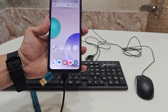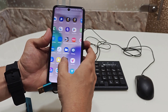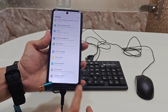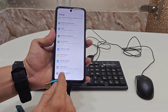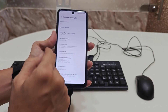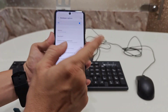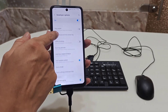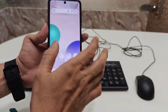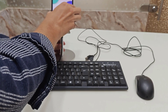After connecting, if the cable is not being detected on your phone, here is what you need to do. Open your phone settings and scroll down to find Developer Options. If Developer Options is not there, go to About Phone, then Software Information, and tap on Build Number four to seven times. You will then get the Developer Option. Open it, enable Developer Options, scroll down, find USB Debugging, and enable that as well. Now you are good to go.